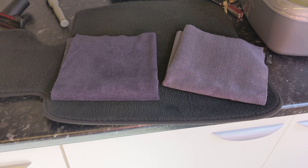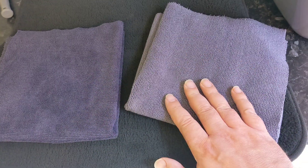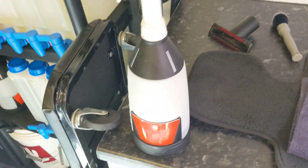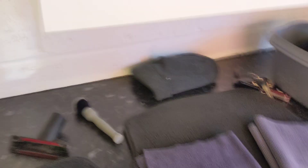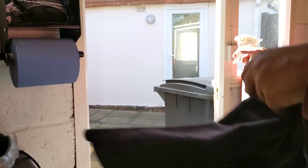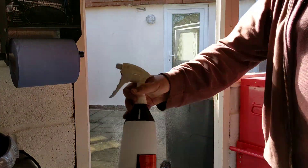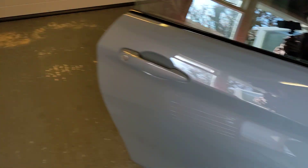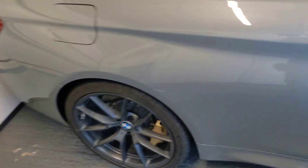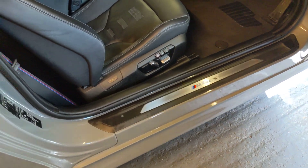But how should you really clean 99% of the interior of a car — or how I do it anyway? Obviously it depends how dirty it is. So here I have a wet microfiber towel soaked out in water, here I have a dry microfiber towel, and here I have APC. I'm not going to be foaming this around. All I will do — literally the interior of the car — is just like that. Just a tiny light bit of APC on the surface, because APC really needs to be rinsed up, picked up via a rinse. You can't rinse the inside of your car, so if you're not breaking down heavy amounts of dirt, just water and a tiny bit of APC generally works.